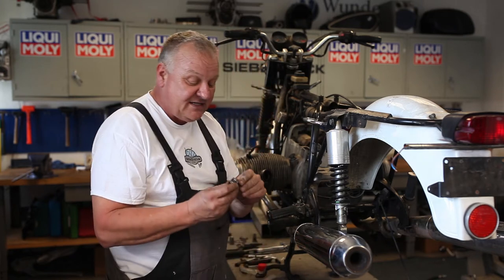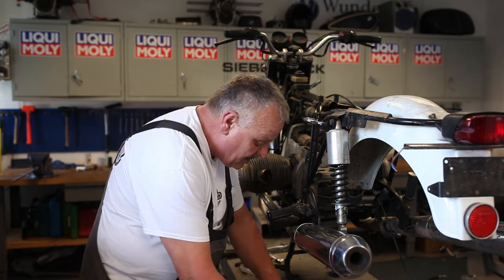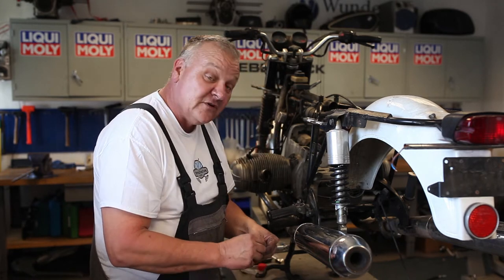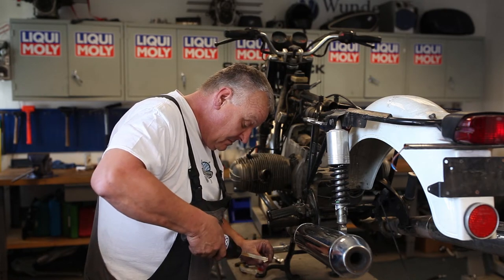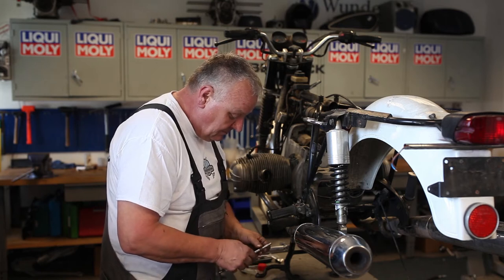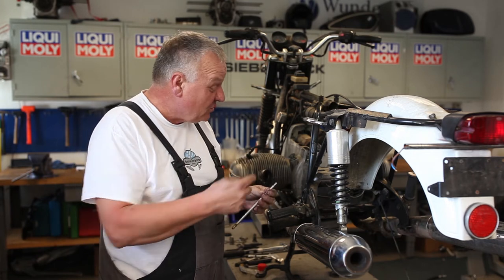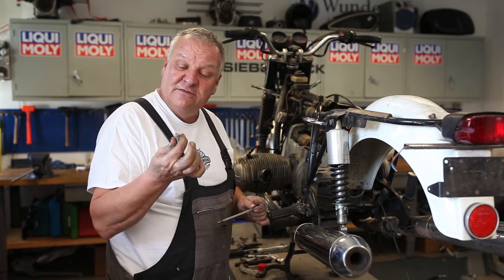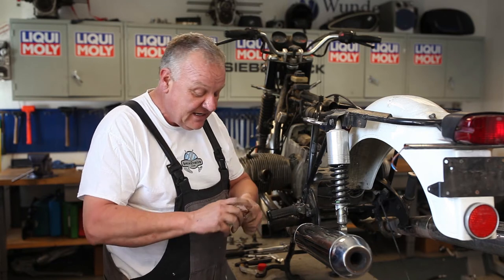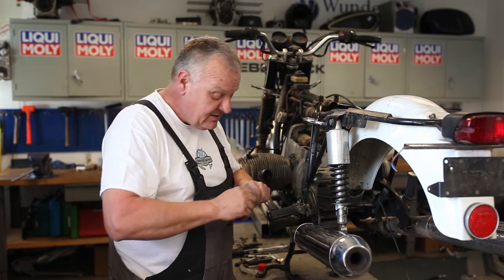On the piston, I'm going to change out the seal. And on the rod, I'm going to change out this felt — it's a good idea to soak that in some gear oil first. I've soaked the felt in oil. These tips are difficult to push into the bearing — it's a tight fit. So I have a bushing I made: I put the felt into the bushing first, do all the work off the bike, then once the felt is inside the bushing, I just push it right in. Works like a charm.